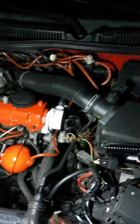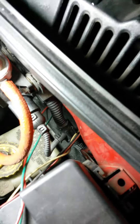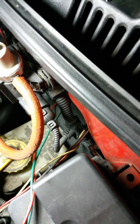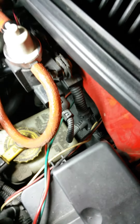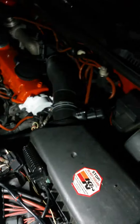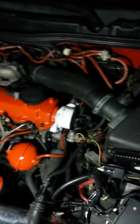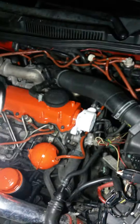Be careful with that plastic line going to your vacuum booster so you don't crack it like I did mine. It's probably leaking anyway — a lot of people say they leak because they're poorly made. But it wouldn't hurt to check it. If you've got everything off already, may as well pull that off and do a vacuum check on it to make sure it's not leaking.